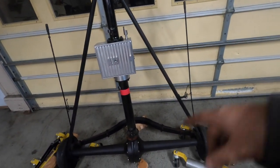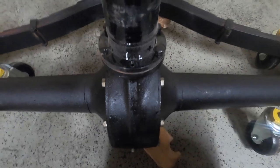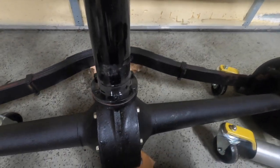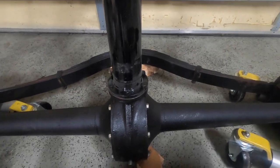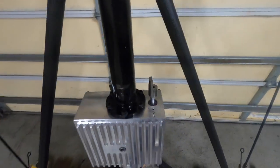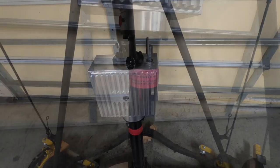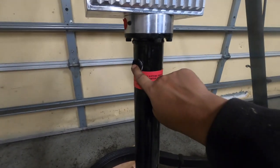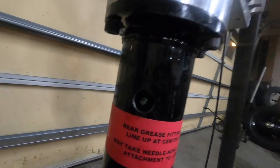Now I've got the splines lined up and the unit has sat down completely. You can see the little plugs I was talking about earlier that I used as guide pins — they ended up working out perfectly. I was able to get the rest of the bolts started in here. I'll finish installing those, remove the plugs, reinstall the original bolts, come through with some safety wire, then reinstall the bolt up top. Then we should be good to lay this thing flat and start getting it ready to go back underneath the car.